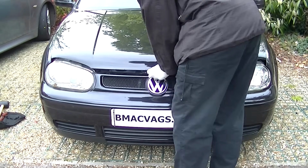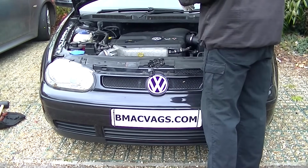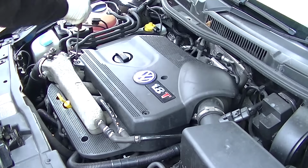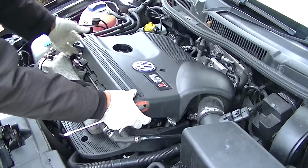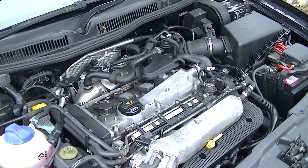Okay, so installation on Mark IV is pretty easy because it comes with a recirculation valve. I mean, most turbo cars come with a recirculation valve, but our one is on the top, nice and simple. Now it's just about removing these engine covers with a quarter of a turn. You see it just jumped up there. Lift it up. Really easy stuff, and you've got access virtually to it.